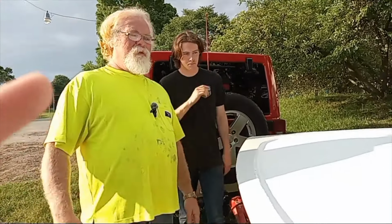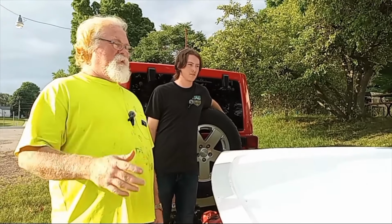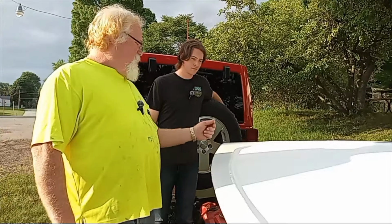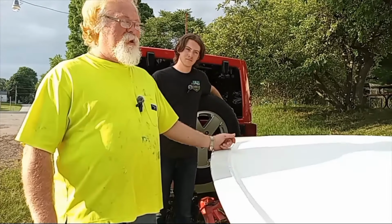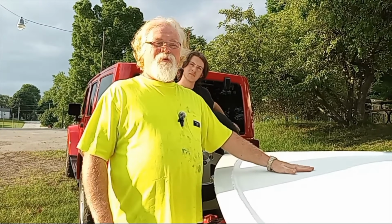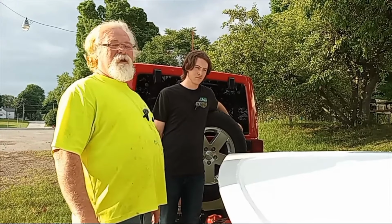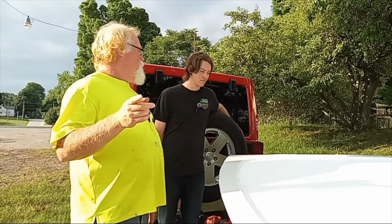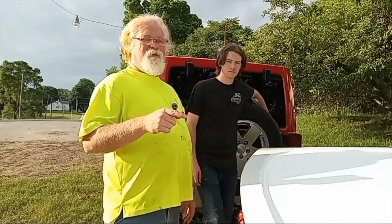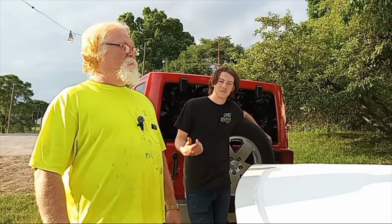Well, that's okay. Because now we're going to sand it and we're going to beauty finish it. And make it nice and smooth. Since we have to lay paint again and we have white gel coat on the deck, I think the gel coat is just going to be our primer, and I think we're going to spray a whole bunch of white paint because I got a whole gallon of single stage Western paint, and once this gel's fully cured, we'll give it another day to cure. We're going to sand and prep it, but we messed it up and we didn't even know.